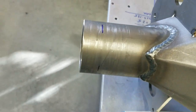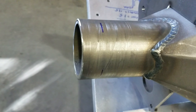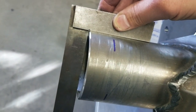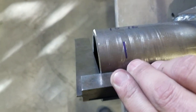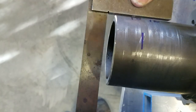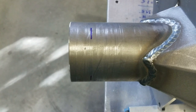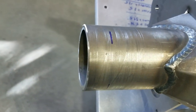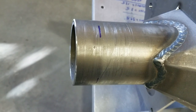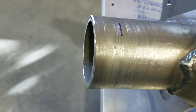Here's the housing cut down to length on one side. Just wanted to show a quick little tip: not all of us are lucky enough to have a lathe big enough to turn a whole housing to face off the axle tubes. So once you cut it, take your square and verify it in multiple places that you're pretty darn square. If you're not — which you more than likely won't be, as most bandsaws aren't going to cut a perfect square — you can highlight the areas that are high and take a simple sander or a four-and-a-half inch grinder with sanding pads and touch up those spots. Go slow, take your time, and you can get that tube pretty darn square.